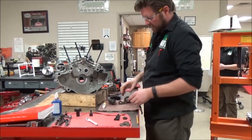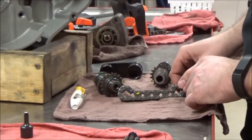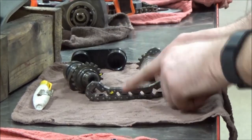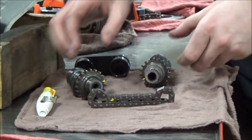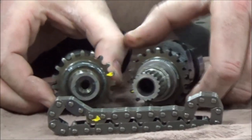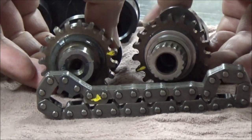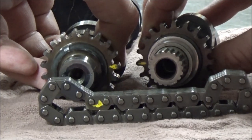The other day we took our cams out, and per the Harley service manual — on every mechanic should know type mentality — we marked our chain on the outside so that we know how to put it back on and run it in the same pattern. I went ahead and painted the timing marks here. With these yellow marks, what we need to do is wrap that chain around and have those marks line up with each other.